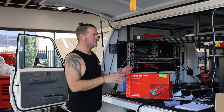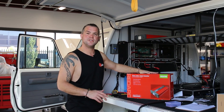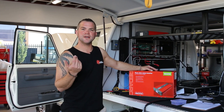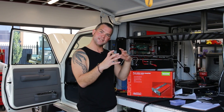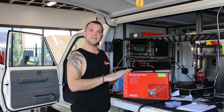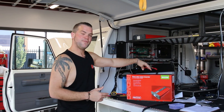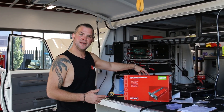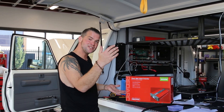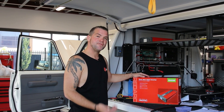But for a 1300 watt coffee machine, always leave a little bit of wiggle room — I would go up to the next bigger one. This we usually use for pod machines that are about 1050 to 1100 watts. You can look on the appliance you want to run — there should be a little label saying what the wattage is. Then you look for the inverter you're planning to use and put about 20-25% on top of what your appliance uses. That should be the minimum power of your inverter.